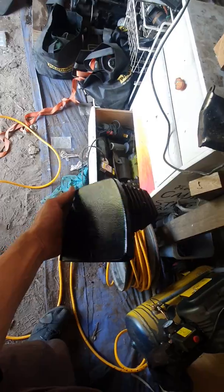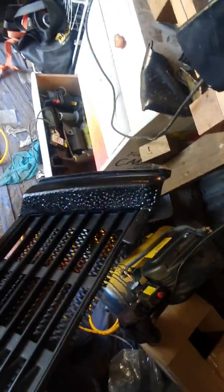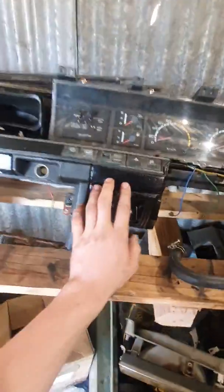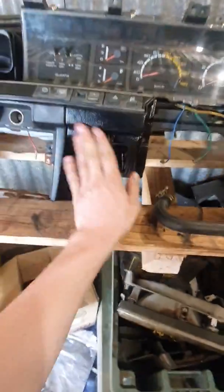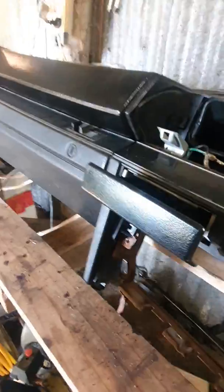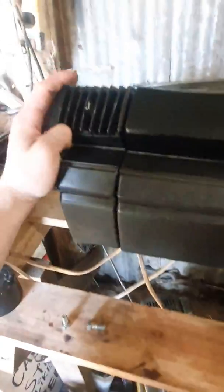These here were actually gray when I put them on. I hit them with some engine black but haven't cleared them yet — still going to sand out a few imperfections. The rubber at the top didn't come out great, but that's an easy fix. This one here was actually blue and I painted it black. The ashtray was brown, so I've got to sand that back — that one got a hit with clear as my first test. I'm tempted to paint the entire dash black, but I might just keep a couple bits gloss black and find replacements when I can.